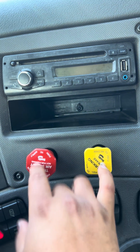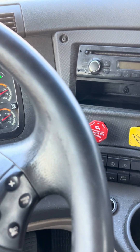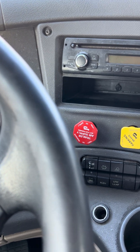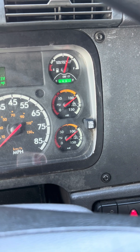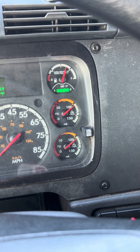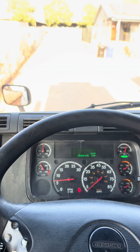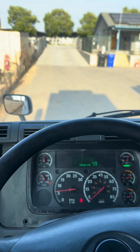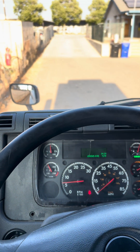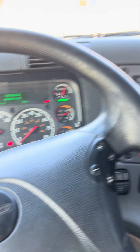Next, I'll be performing my service brake test. For this test, I'm going to release both my brakes and pull forward roughly three to five feet. I'm going to wait for all the air to dispense completely out of the system. Once all the air is completely out, come off the clutch nice and slow, go three to five feet, and then come to a complete stop. Set your brakes, go into neutral, and turn off the truck.